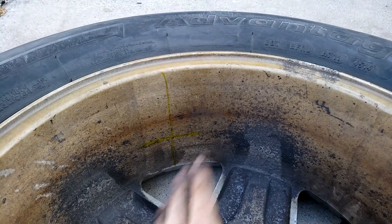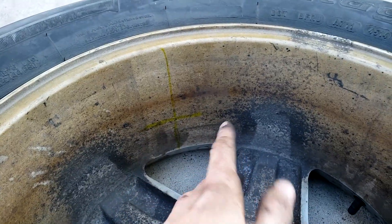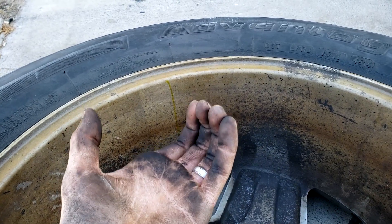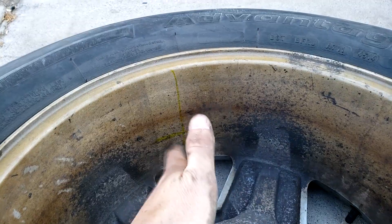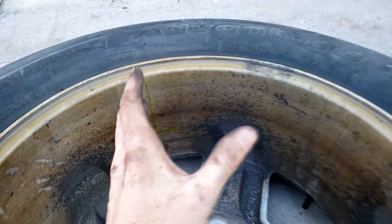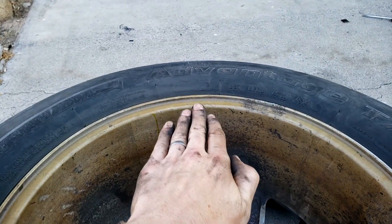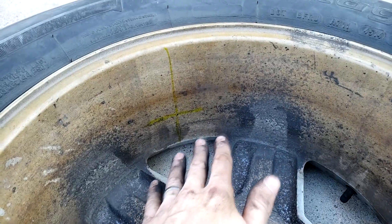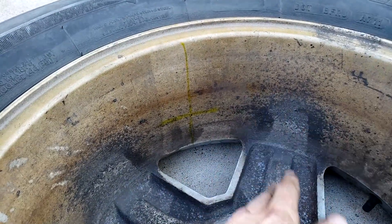The last thing to mention is static versus dynamic balancing. Dynamic balancing you should always do — you can use machines that cost a few thousand dollars or take it into a balancing center. The wider the wheel, the more important dynamic balancing is. If you have skinny car wheels, you might be okay with a static balance. So if you have a rumble on the freeway at 60 miles an hour, you do this procedure and it's gone, maybe it's okay for you. But I do recommend dynamic balancing. A bubble balancer isn't going to do dynamic balancing — dynamic balancing addresses both the main plane and the edges of the wheel. This is called a static bubble balancer. It's for static balancing, not dynamic balancing. If your rumble goes away doing static balancing, then it's okay for you.